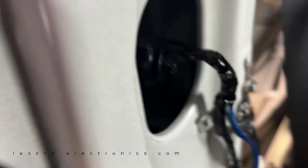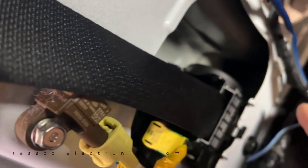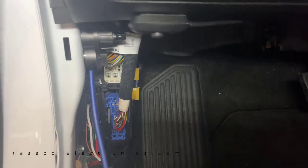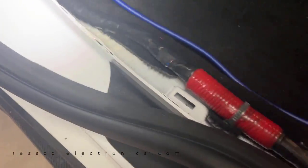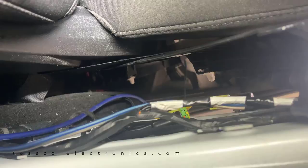The wire is completely connected into the driver boot - all taped up, harness back the way it was, following the factory harness, tapping onto it every six or seven inches. Let me show you how this power cable runs through the vehicle. It goes up behind the hood switch - it's hard to show. It goes up, over, through a hole I added for LED lights, but there's already a factory grommet so I just punched through there for my power cable. Running down through here, you want to leave it loose, go on the inside, always behind all the factory loom and factory harnesses, into the back.